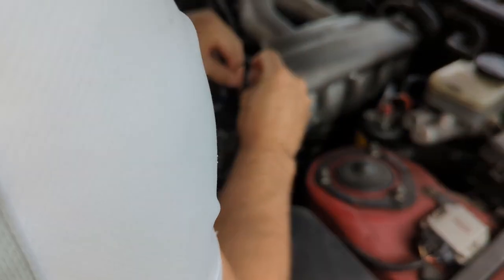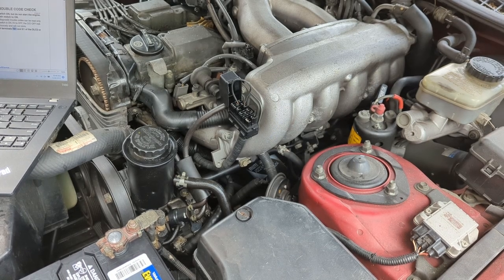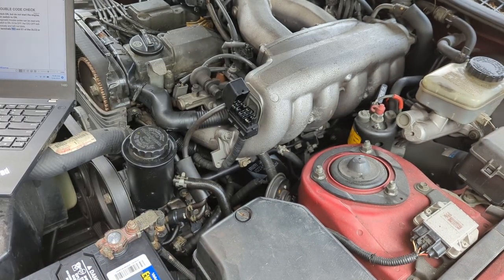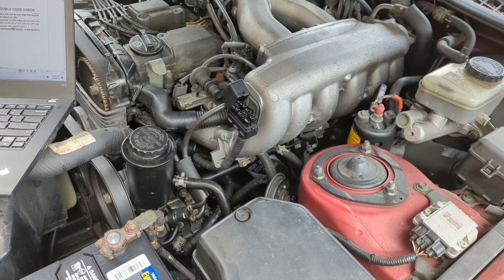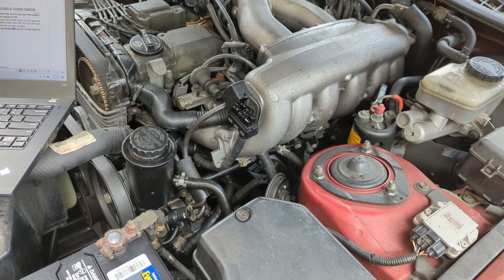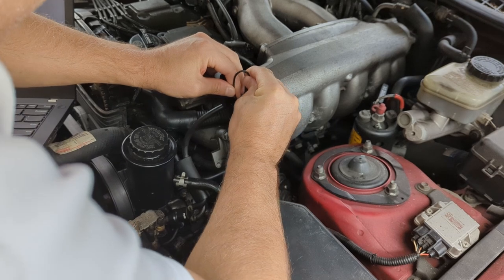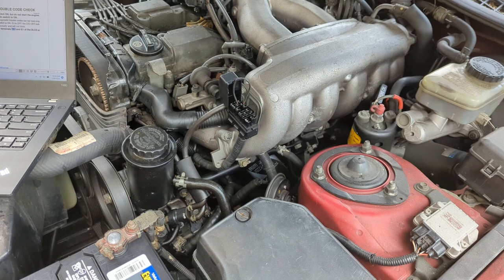And I think a number 14 wire might be too big. But maybe not. Although I may have had to put the ignition switch on first. Yeah, probably. So this is turn the ignition switch on, but do not start the engine. Push the overdrive main switch to on. But I think this is also in the transmission section, so that part probably doesn't matter all that much. Let's do key on. All right, we are key on. Short out those two terminals again, and then we'll go and look at the check engine light.